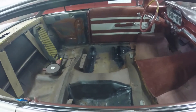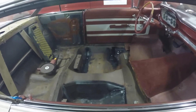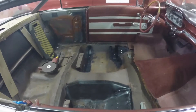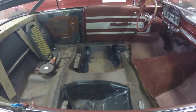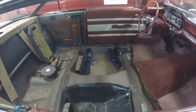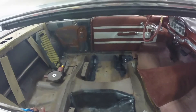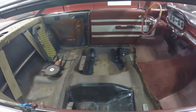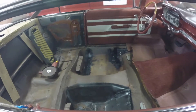I'm going to give the car a start — we'll do a cold start. It's been a couple months since it's been started, so I'm sure all the gas has evaporated out of the float bowl. I'll just crank it over a little bit before I hit the accelerator. I don't like to pump the gas pedal with no gas in the float — there's nothing good about running a dry accelerator pump up and down the bore. So I'll give it a little crank, then set the choke and it should start right up.